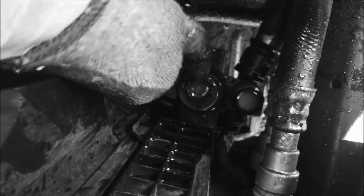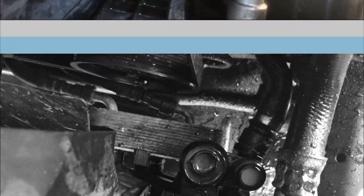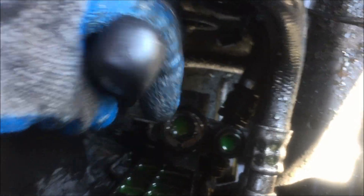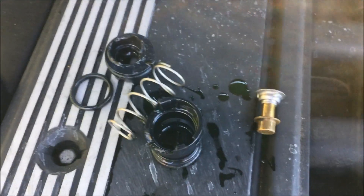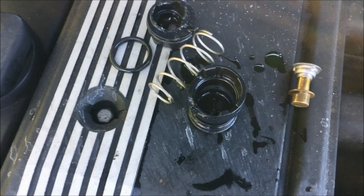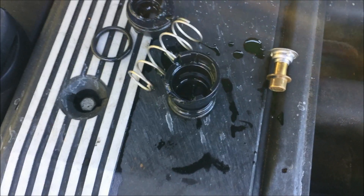There's a thermostat here you're going to want to replace, and you just press the new one in along with the new coolant reservoir. Getting this thermostat out is difficult. You don't want to use anything that will press up against the edge, so I've been putting a screwdriver in there and prying it up a little — it's not pretty, but this is what's left of the coolant reservoir thermostat. You've got to make sure you get all the pieces out, because these plastic parts basically just break down over time and fall apart.